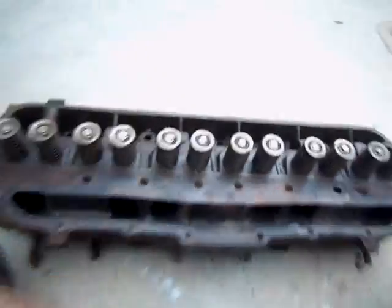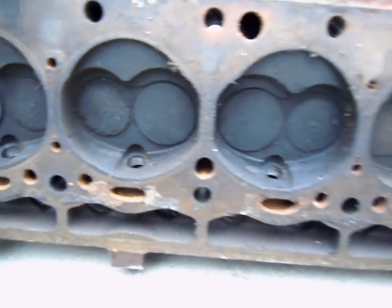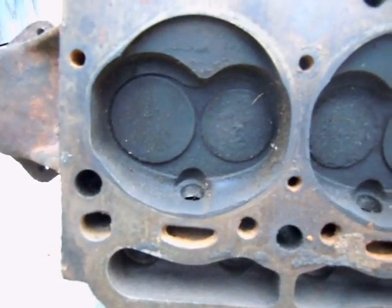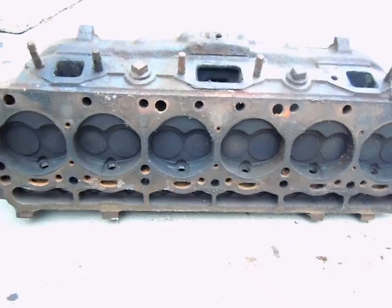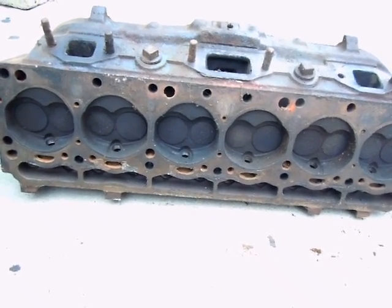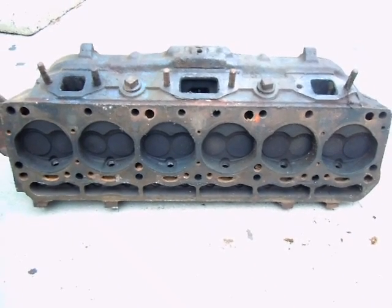From what I remember about this motor, the piston-to-valve clearance is huge. It's an 8.7-to-1 compression ratio, but it's almost got flat-top pistons with all this room up in the combustion chamber. I was thinking maybe changing to dome pistons, or installing some slightly bigger valves. I definitely want to try a different cam — have the cam re-ground. The average cam duration is really short, about 215-220 degrees. The lift on the valves is like 0.37 on the intake and 0.35 on the exhaust. Really just pathetic. With a little head work and a better cam with more lift, just moving more air through this motor is going to make it run so much better.